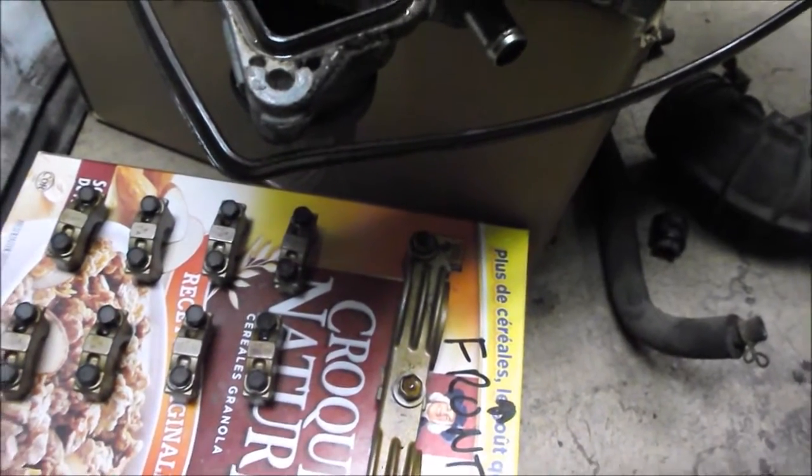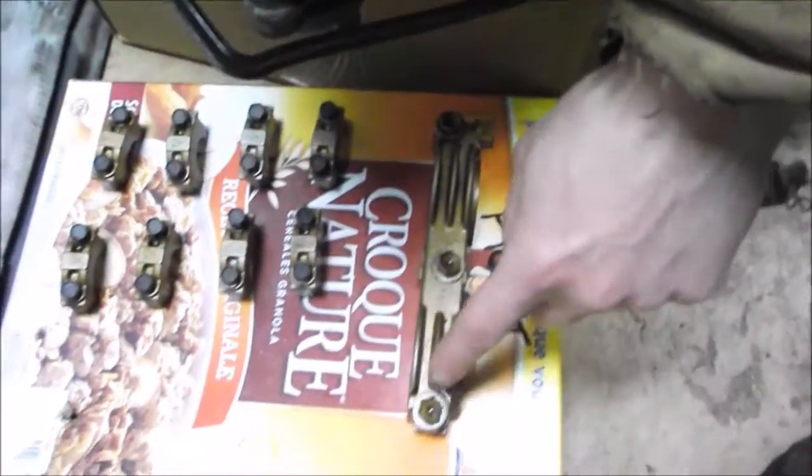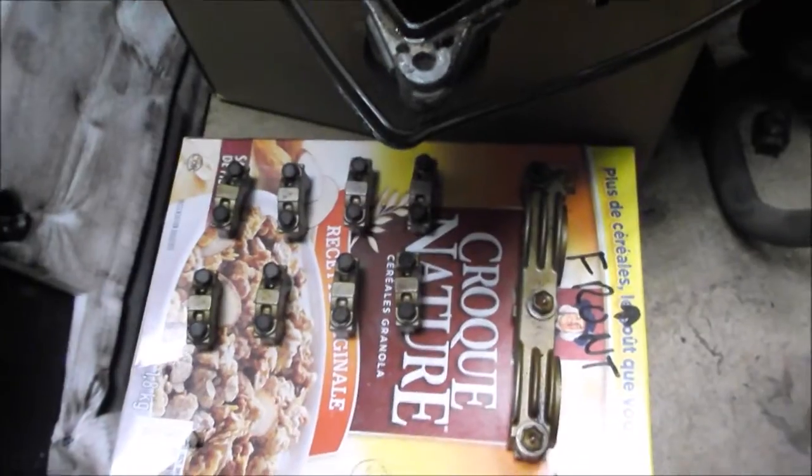The caps have a directional arrow and are numbered two through five, because bearing cap one is shared between the two camshafts, then they go two, three, four, five.